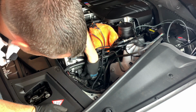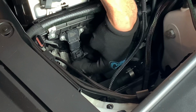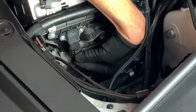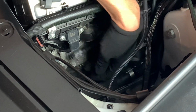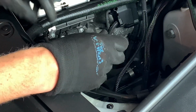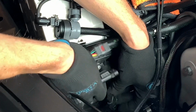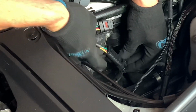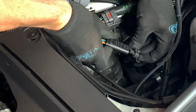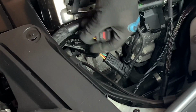We disconnect. And all you have to do is push down on this T-map connector. Push down right here. Push down the little flap and pull out. Once it's out like that, this is what makes the JB4 easy to do, because you're gonna have two connectors here. One is gonna connect your existing connector. Put it like this way. It can only go one way, so make sure it's down like this till it clicks. Make sure it clicks.